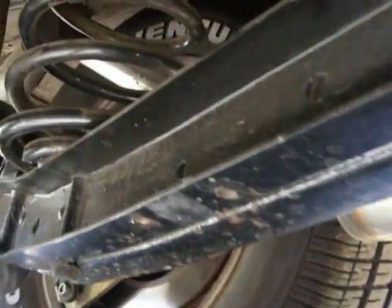Somebody asked me about the part on this thing, so here you go. It's CPP Classic 6102-2, and the rears are also CPP, and I don't know if there's a part number on those or not. But I do remember, because this was more of a criticality for me, that any more than 3-inch lowering on the back and you have problems, then you have to notch the rear part of the frame, and I didn't want to go through all that. And thank God she was happy with the ride that it ended up with.